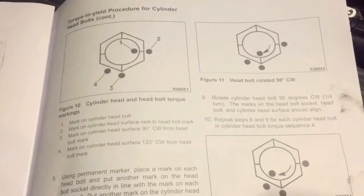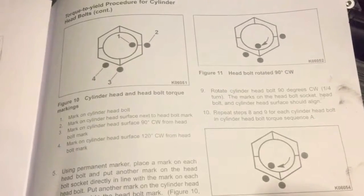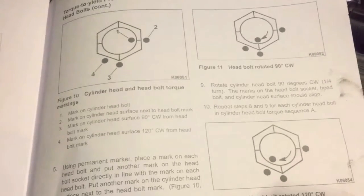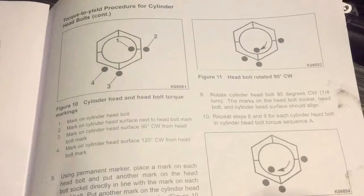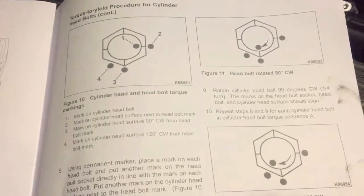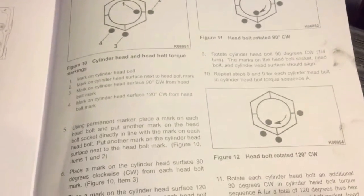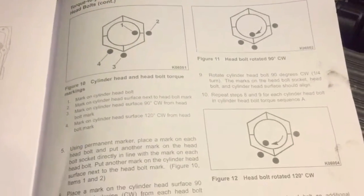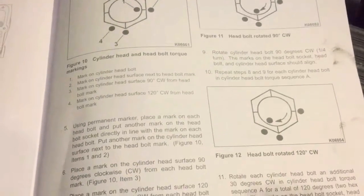Then they go to this diagram where you're supposed to mark the bolt — at 150 foot-pounds you put a mark, then rotate 90 degrees, and then add another 30 degrees. Basically once you get them to 150, you do a quarter turn and then just a tad bit more, which is about 30 degrees give or take. That's what we're going to be doing — we're going to follow the instructions and see if we can get this head torqued down so we can continue tomorrow finishing the assembly of this unit.